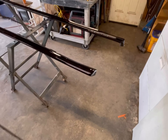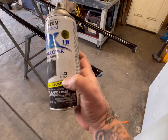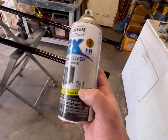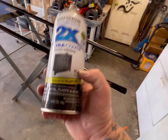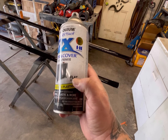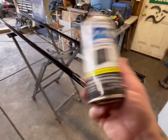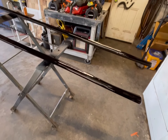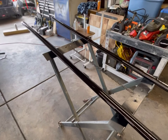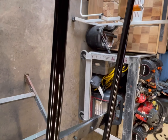The paint we're using is Rust-Oleum Painter's Touch 2X Ultra Cover paint plus primer, flat black. If you're going to do this kind of painting, always get either flat black or matte black — that way when you put the clear on, it won't bubble or do weird stuff. Get flat or matte black any time you do this kind of painting. It doesn't have to be black — it could be any color, just get the matte or flat version and then use the clear coat on top.